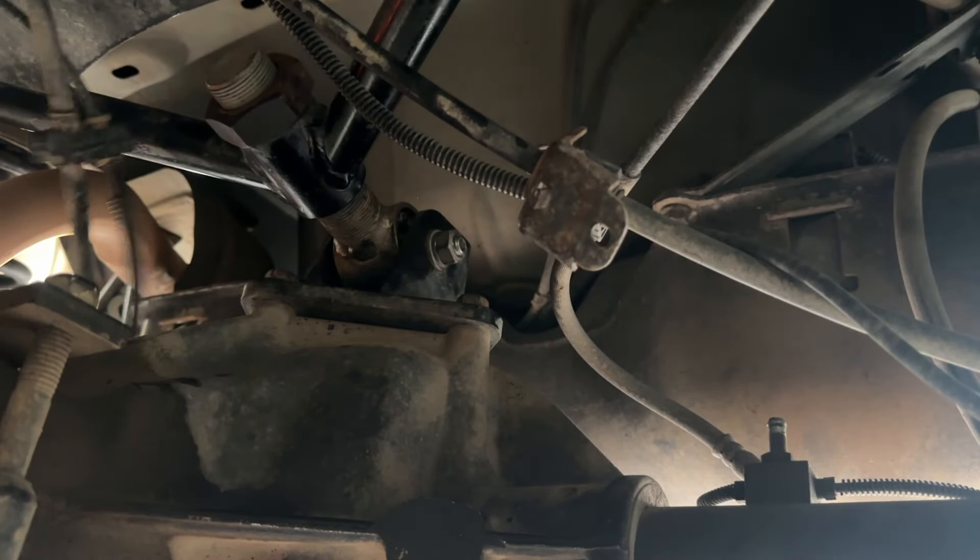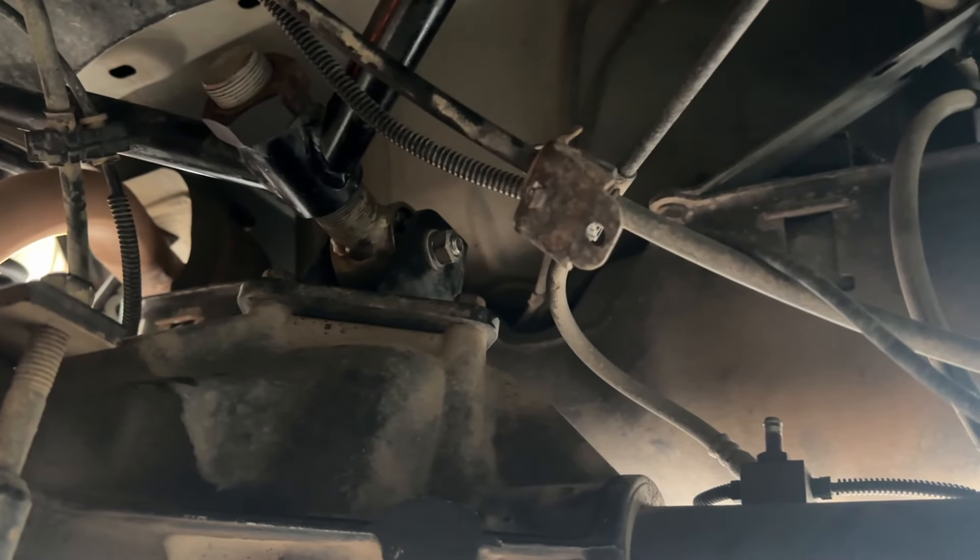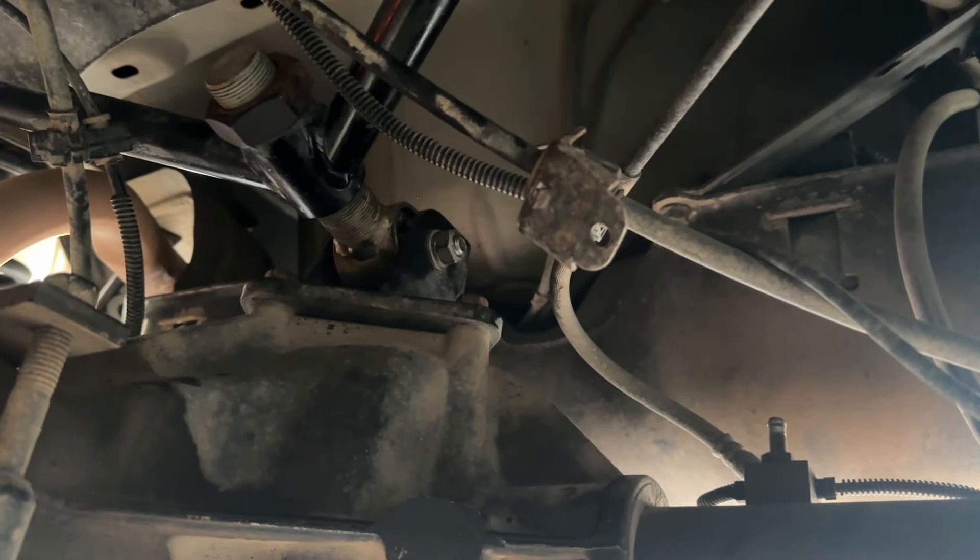We got it all torqued down and now it's no longer making any noise. I think that's all it needed — just to be torqued down. So I learned a lot today: the fact that those joints are actually good. We got it all back together and when I move the Jeep there's no more clunk. Over time some of the stuff got loose, we put grease in because it definitely needed it, and torqued everything down — the small bolts to 85 inch-pounds and the larger bolt that holds the bushing in place to 120 foot-pounds. Now everything seems solid.